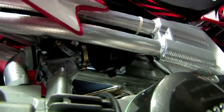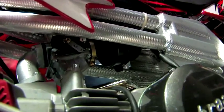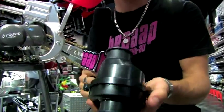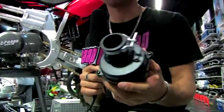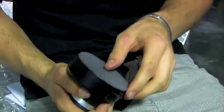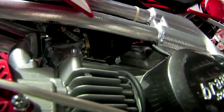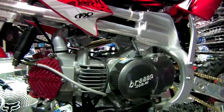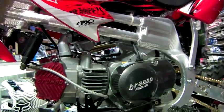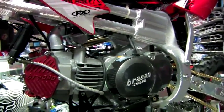On the 2010 Braapster Maestro, we've built an airbox and spark arrester onto the back of the carby. This makes the bike suck less water and dust, with no chance of fire — it's really safe and cool. It's easy to change the air filter because it bolts onto the end of the carby like a normal air filter, so you don't have to reach inside a traditional airbox. The 150cc Maestro also has an oversized carby. On the Maestro, you choose between three engines: a 125cc, a 140cc, or a 150cc with the KLX style head.